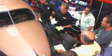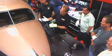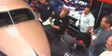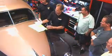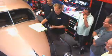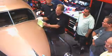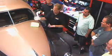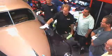It looks like liquid paint, it's so glossy. We don't want to mar it, so you want to fold it so it spreads out the pressure of your hand. If you lay this thing down flat, the pressure of your fingers and fingertips and the high point of your palm will press right on the paint. You could actually mar the paint. When you fold it four ways, you have some cushion there. You have eight sides to wipe with, and that's why you do that.